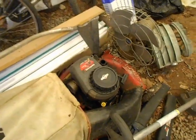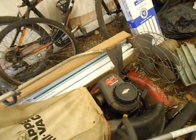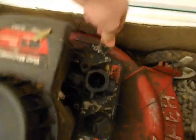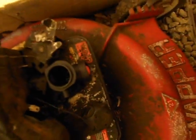I've just got to figure out something to do with this, because this engine, of course, is newer. It's supposed to have one of those safety handles with the annoying thing that you pull down, but it doesn't currently have that. This mower's old. It's just got a start-stop thing. It's supposed to be a speed control, but I'm not going to get the speed control hooked up. I had it hooked up at some point, I don't remember. There's your air vane. This is the kill wire. I could just take this whole thing off and run a kill wire and have a kill switch up there, I guess. I don't know. That's a project that I was playing around with and never actually did anything with.